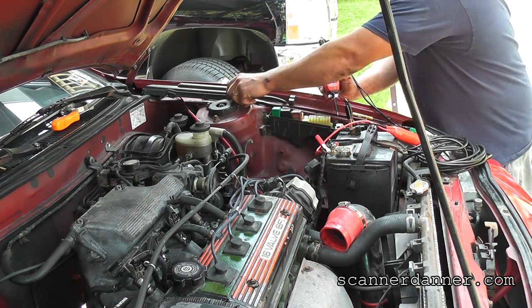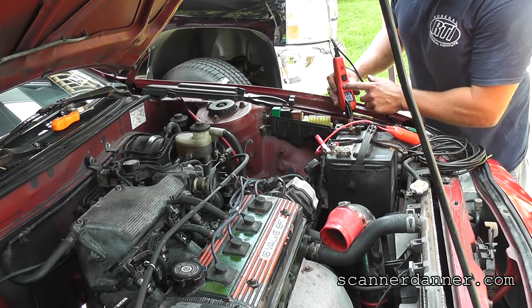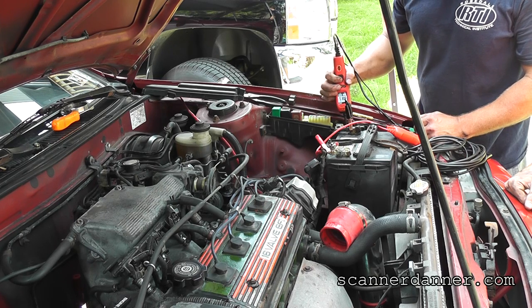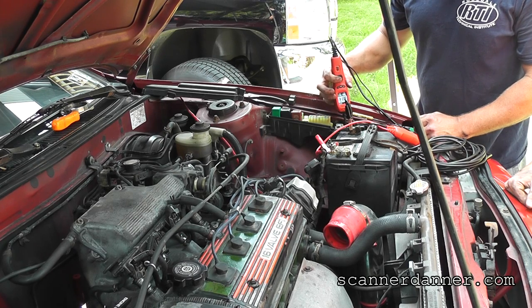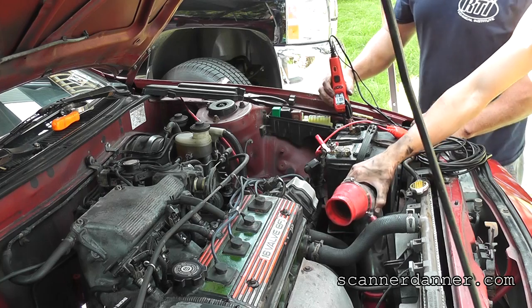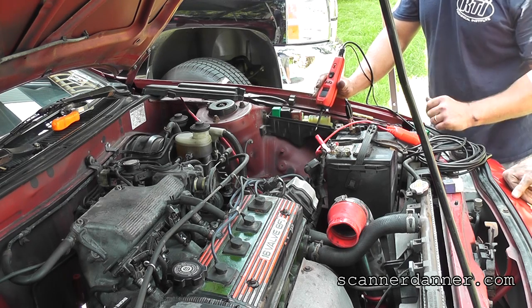So on this one, again, the load side was pin 3. 5 was hot, right? 5, we had 12 volts here. Yes. And I'll put the beeper on for you. That's the hot feed. And then this would be the ground, but if I hit the button, turn that beeper off, right? That's pretty cool. And that drop that we were seeing, that's 10.2. That's just a current flow that's causing that voltage drop on this circuit, and nothing wrong with that. So what else was I going to tell you?